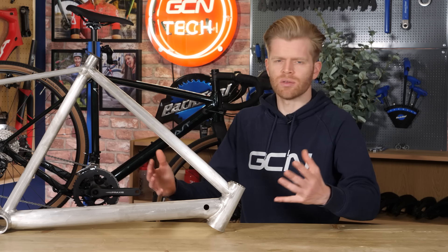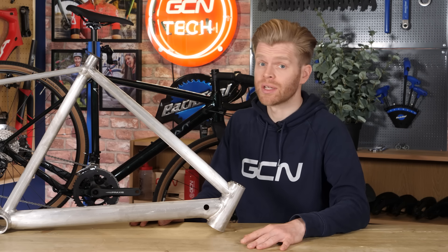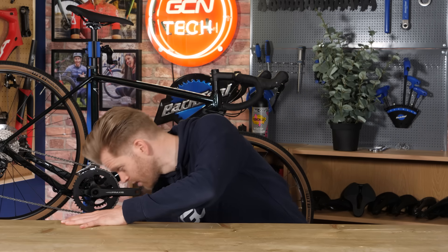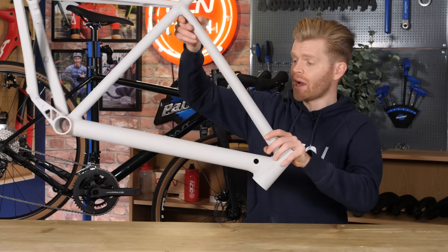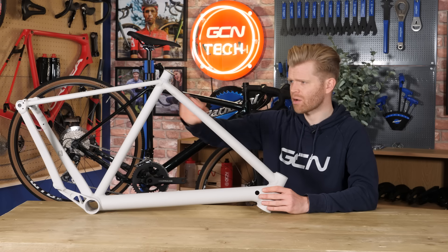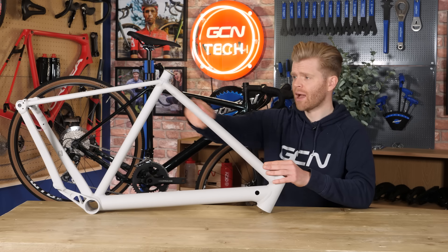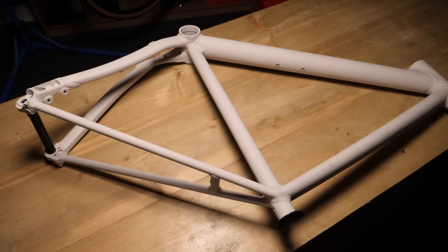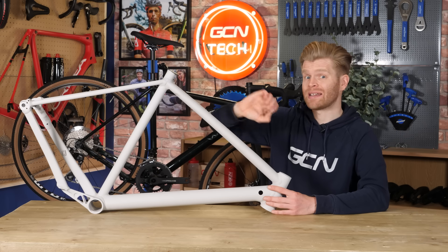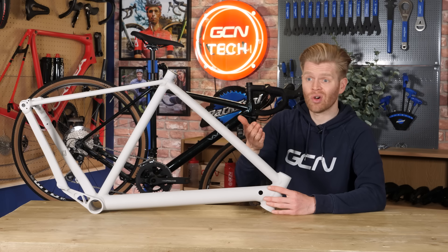But wait — magnesium corrodes. What about that? Well, you're right, magnesium does corrode. That's partly down to the fact that it is a pretty reactive metal. However, that's why you don't ride a bare magnesium frame, but instead use one that's been surface coated inside and out and then painted. This is a special ceramic oxide coating applied using a technique known as plasma electrolytic oxidation. This surface-hardens the outer surface and provides a significant barrier against oxidation. If you scratch the frame through to the base metal, that will open up a gap whereby corrosion can then ingress and take place — but this is much the same as an aluminum frame or a steel frame.